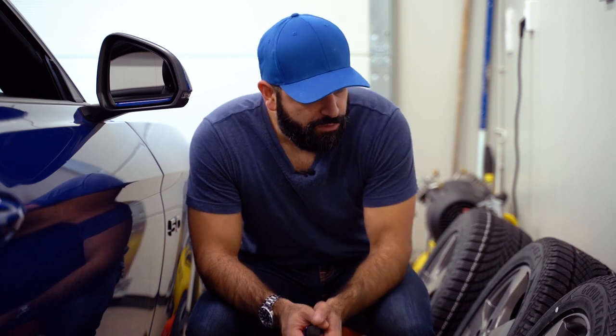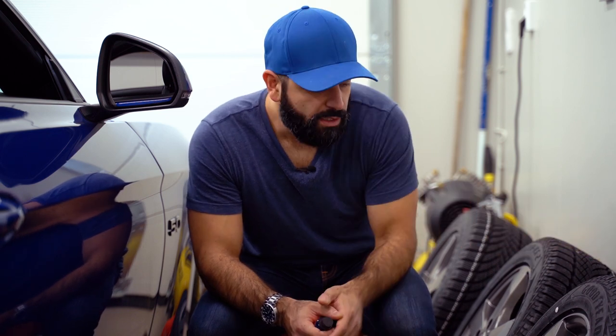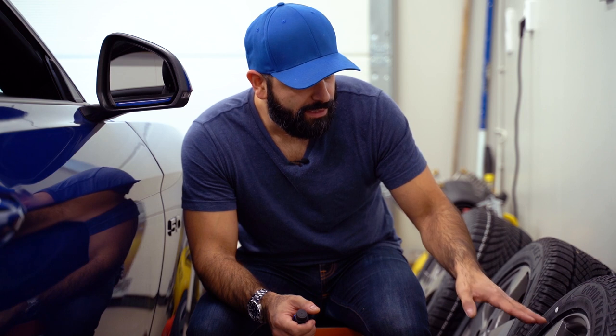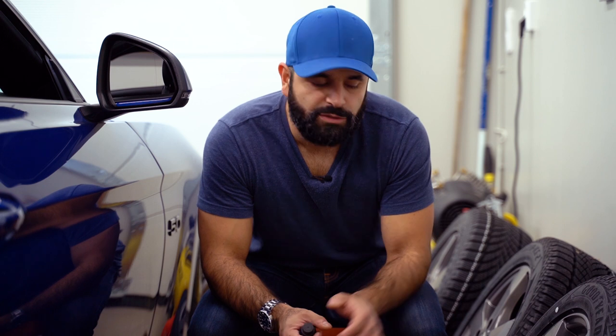In today's episode we went through how to prepare the wheels before ceramic coating, and the steps are more or less the same whether the wheels are new or used — though with used wheels you need to make sure the surface is as clean as possible. CarPro recommends no water contact within the first three hours. If you do get any water on the wheels within the first 24 hours, CarPro recommends removing it right away, as you can get water spots in the ceramic coating before it has cured.